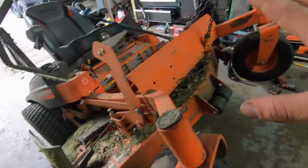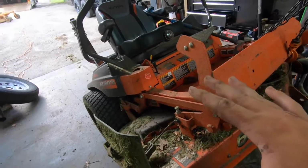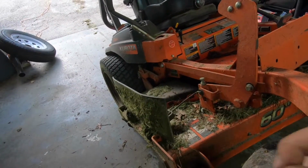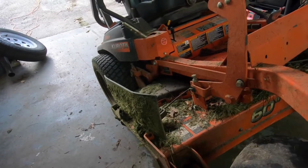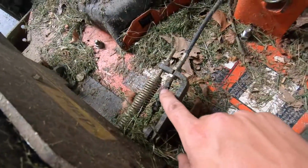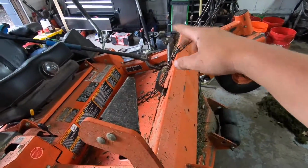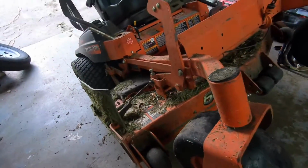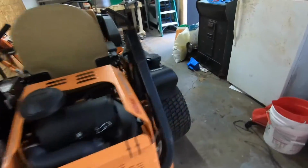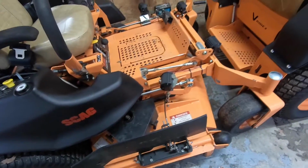Guys, if you run grass flaps, I know a lot of people talk about the cables going bad, which is true. They are going to go bad just from overtime usage and whatnot, but it doesn't hurt every so often to pull your cable off, squirt a bit of WD-40 down behind here, and just shake the cable up and down, flip it over, do it on this side as well, and that helps lubricate it and keep it clean. I'm pretty sure Zach has actually had the same grass flap on his mower for at least 2 years now, and I'm 90% sure it's the original cable.